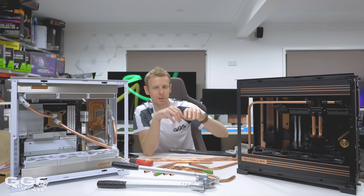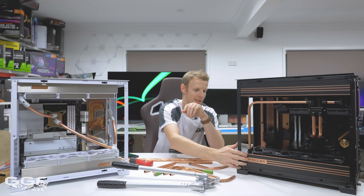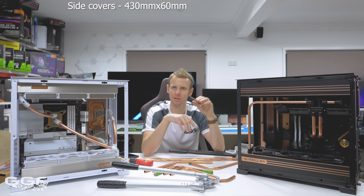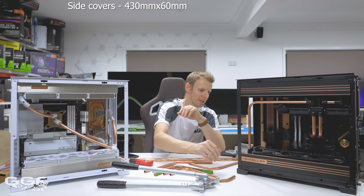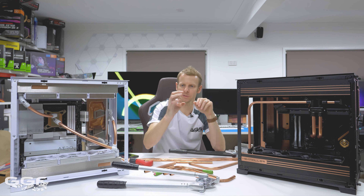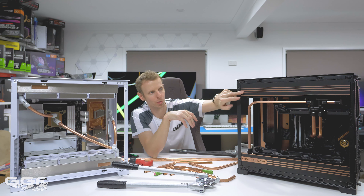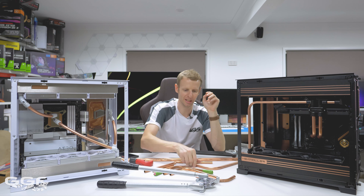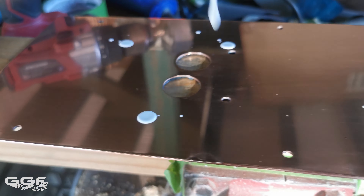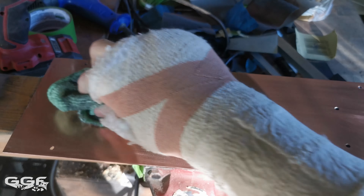The side panels here are like the previous builds I did - the Lian Li O11 Air Mini where I covered the panels. These ones are a bit different though. These are actually copper sheets I got off a friend. They've just been cut down to size and I will put the measurements in the description. They are just double-sided taped in the frame. The one up top here does have a fill piece - it's attached directly to the radiator, with a bit of a square block of aluminum that runs along held on with some heavy duty double-sided tape. These were all cut to size and sanded the same as the tubes: 600, 1200, 2000, 3000 grit. The surface area is so much larger and I'm just doing these by standard drill and by hand, so it does take a lot longer.